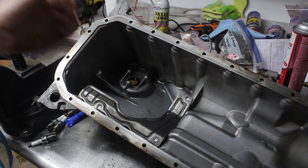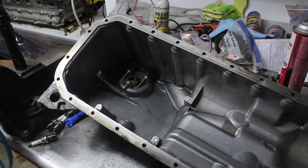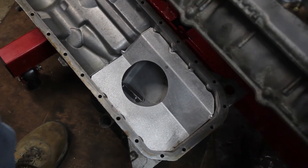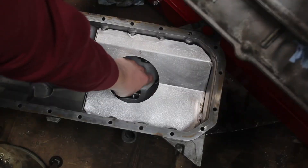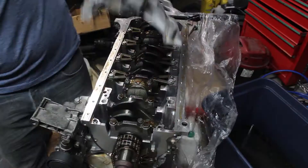After tightening the nut, it's time to install a new oil pan baffle. I drilled out the rivets holding in the old one, and filed them down flush. Then I had a friend weld a new baffle in, because it's aluminum and very difficult to do yourself. I got that baffle from Vimmerworld, and it's got these nice flaps for controlling the oil flow. This will make sure my engine doesn't get oil-starved in long, high-G corners.